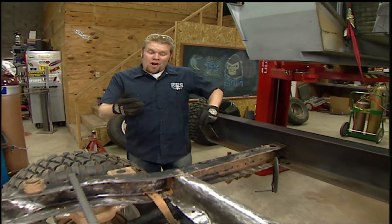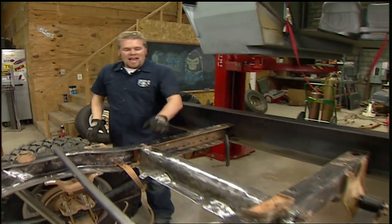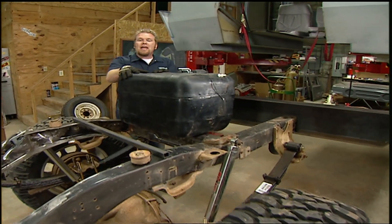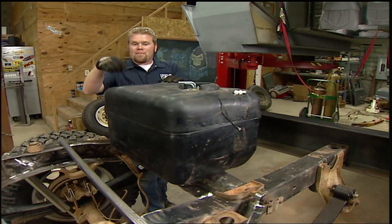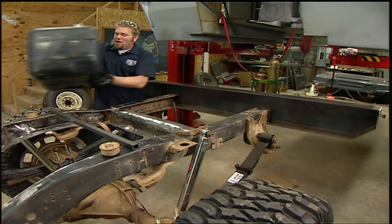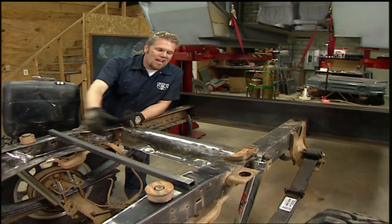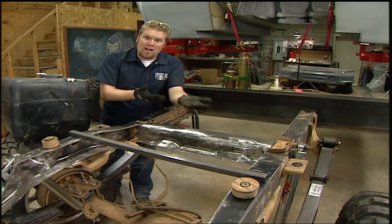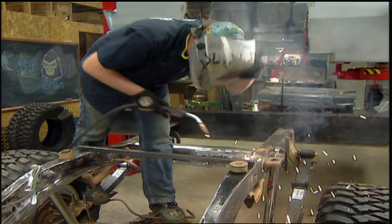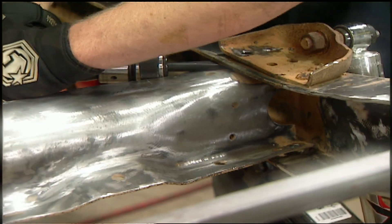The part Jesse is talking about is a cross member like this one right here. We already pulled one out of the front of this frame to put the Duramax in place, and this one right here is in the way of our fuel tank. This 21-gallon polyethylene tank came with our Urban Gorilla body kit and we want to lower it between the frame rails. We could put it in here, but it's going to get in the way of our winch that we're going to put behind the back bumper. So this cross member has to go. But this adds a lot of strength to the frame — just like rungs on a ladder, this holds the frame together. If you take too many of them out, the frame is going to fall. So if we cut this out, we've got to replace it with something else. With a temporary brace welded to the frame, the factory cross member is removed.